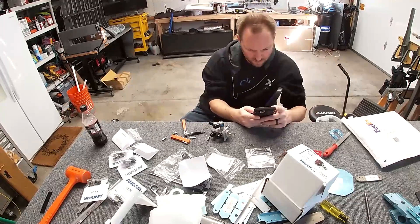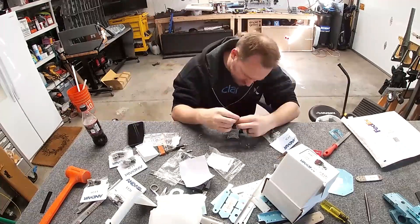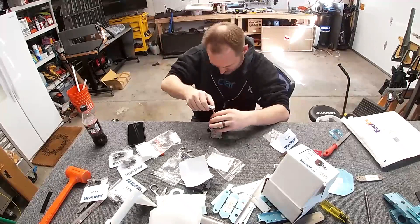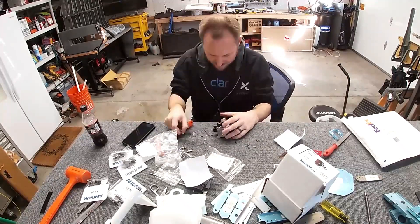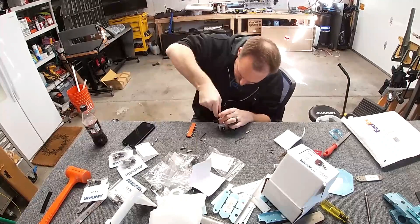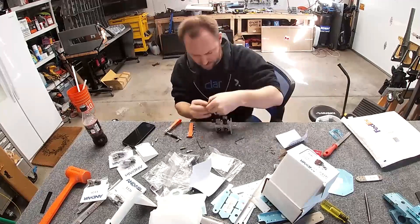This is the video I wish someone had made for me so I knew exactly what to order — so you're welcome, internet. In the United States, if you order this you get the fuel selector with straight fittings. That doesn't work for Vans, because if you read the plans — at least for the RV-14 — you want the fuel lines to point 90 degrees backwards.